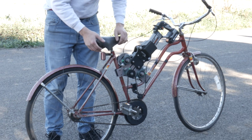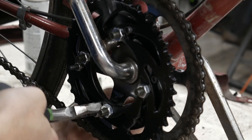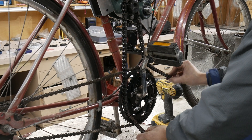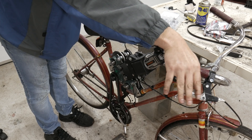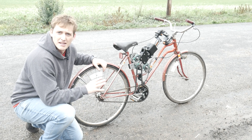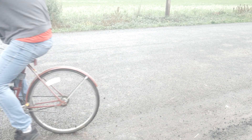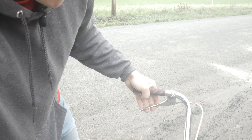It didn't work. For my 3D printed pulleys I don't think I made the grooves deep enough, so I switched to a chain drive - 420 chain, which should be more than enough. I converted it to chain drive. I had a feeling it wouldn't be able to go on its own power immediately and you'd have to pedal it. To my surprise, it actually was able to move with no human assistance. That said, there was more grinding going on in that transmission than a high school prom. The bike is like... imagine a little baby shoved inside the bicycle frame helping you pedal - except this baby will mutilate you if you put your legs in the wrong spot.